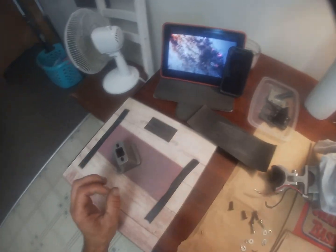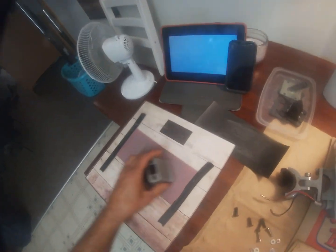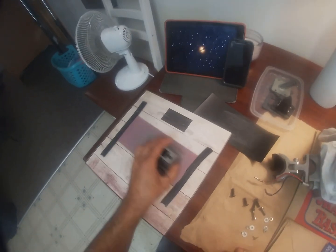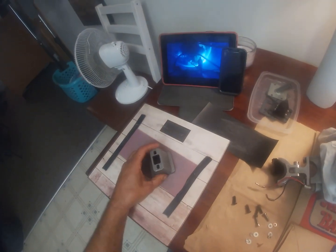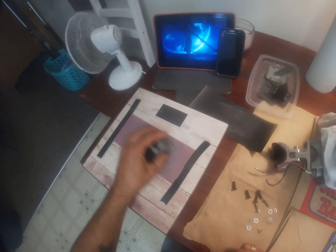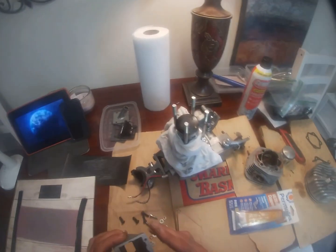So anyway, this is a scale from a store. It's got a thick glass plane, you know, pressure proof, I don't want to say bulletproof, but some kind of Pyrex base. Just gonna do some small circles and do maybe 8 or 10. We're gonna go just an eighth of a turn, so we're gonna go from here to here, you know, to here. Turn it again, just slowly. We don't have far to go. We're just trying to clean this up so it mates really well.